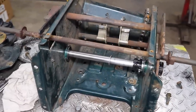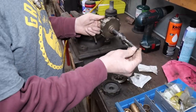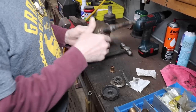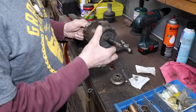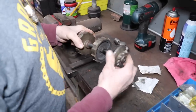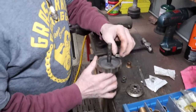For the steering in the back there was some other part that was bad, so I'm going to take you over to the bench and show you what I found and how I'm going to fix it. This is that mechanism in the back — when you pull those little levers it releases these clutches. On this side this was all worn out, all flopping around. The sprocket end has a bushing in there that was worn out too. It's got these planetary gears in there, which is what gives it a differential action.